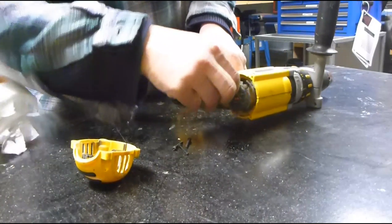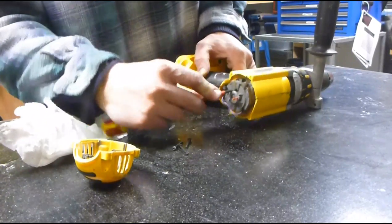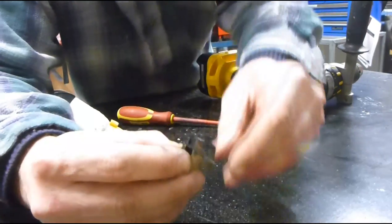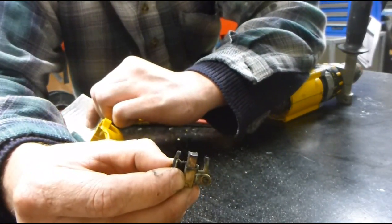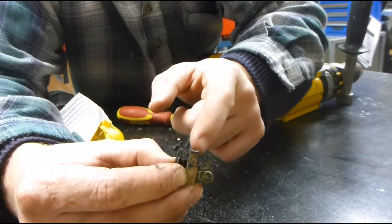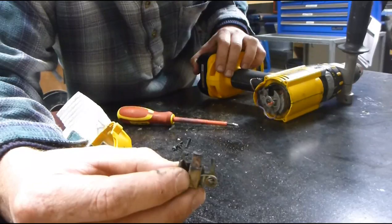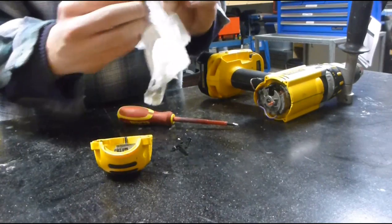These ones are really quite easy to remove. Just pop that little bit out of there. See how it's in a concave-looking arrangement? What that means is the outer edges will be contacting the other bands on the commutator in there, which will cause arcing across it. I'll go over to the bench grinder and show you what I do.